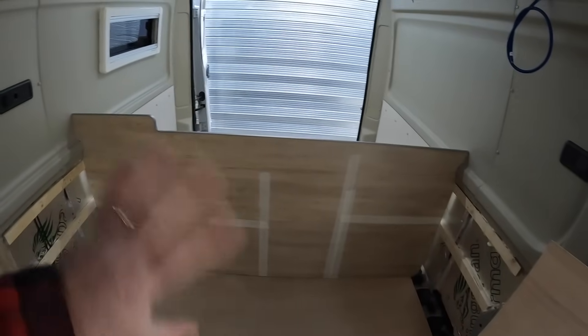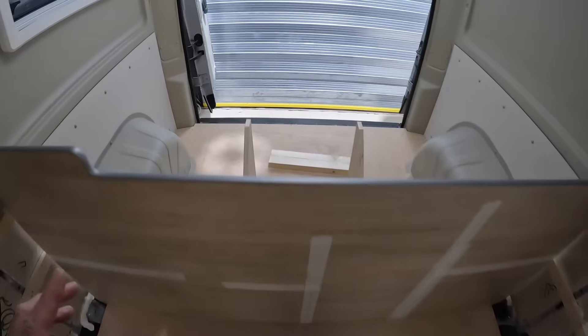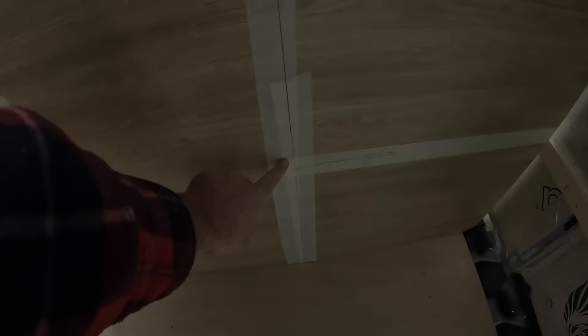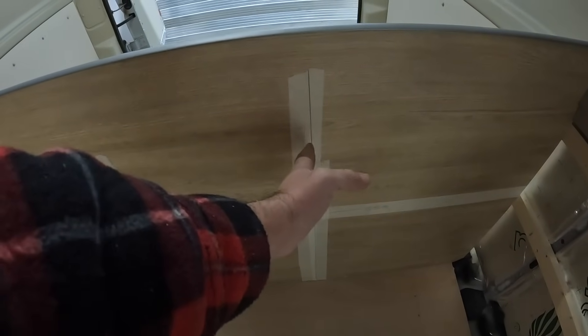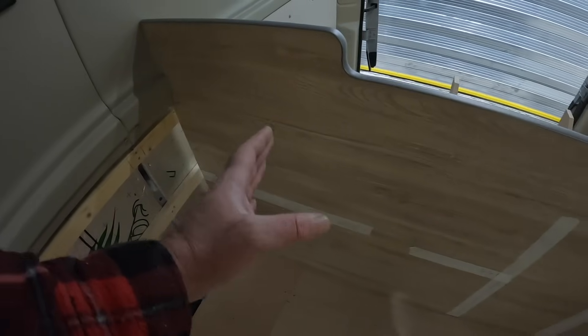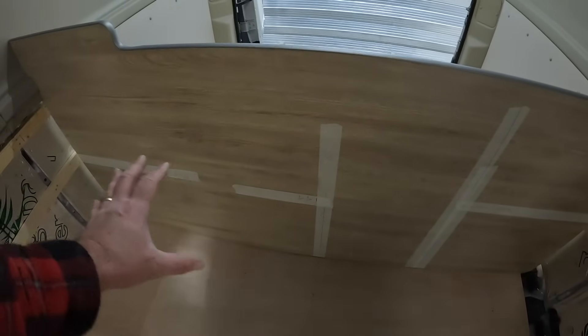I think the main thing now is making sure the back edge of these 4x2s are down and secured strong. I've brought the bulkhead back in and just positioned it roughly — not squared off yet, but that's fine for now. I've positioned the toilet where I believe it's going to go. That piece there is the exact depth and height of the fridge we're using — it's going in a larder and we're raising it up to about here. I've marked the line down there — just roughly — that comes to 550mm, so that's where the front of the fridge is going to be at most. This side we're going to do either 450 or 500mm — I'm hoping for 500 because that still gives us over 800mm gap in the middle, which is plenty.